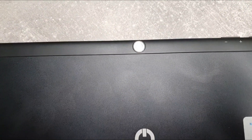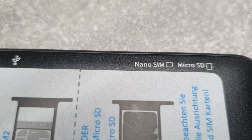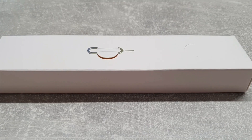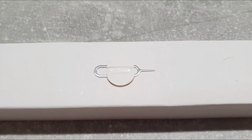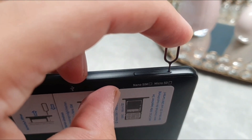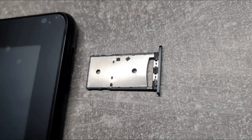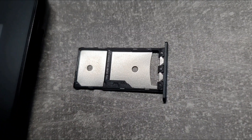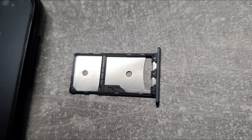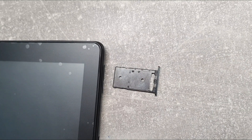That's the back cover and the rear camera. It's written on the back side as well: nano SIMs and micro SD. I forgot to mention there was a box inside the packaging containing the data cables and a pin for the SIM card slot. You put this pin into the hole and push a little bit so the slot pops out. On one side there are two places for two nano SIM cards and a place for a micro SD card — the same as in smartphones. Just remember to align the front side of the tab correctly.